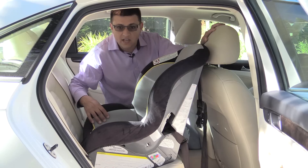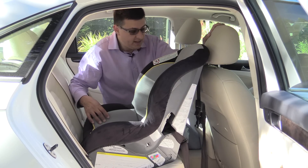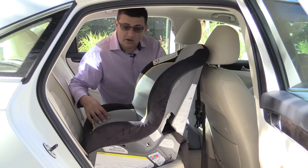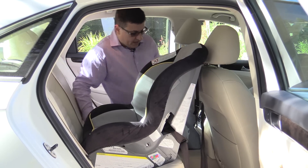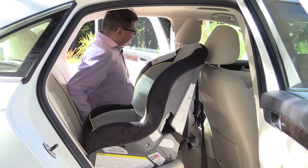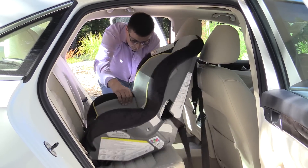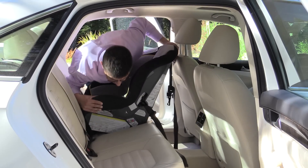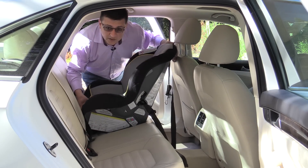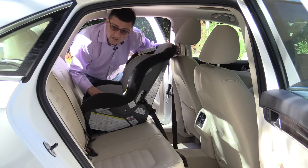It is touching this front seat back, and that's because this front seat back is all the way back in its tracks. That really means you can put a fairly large passenger in this car and still have a child seat behind that person. Moving over to the driver's side — where the front seat was adjusted for me — and aligning the ball into the green zone, you can see I have about two inches of clearance between this rearward-facing child seat and the front seat, which is ideal.